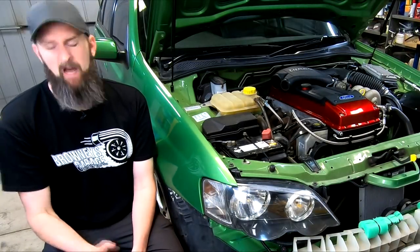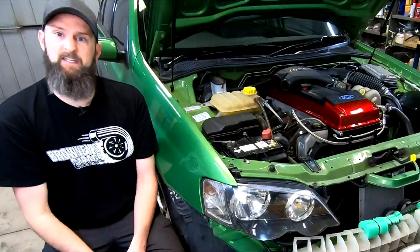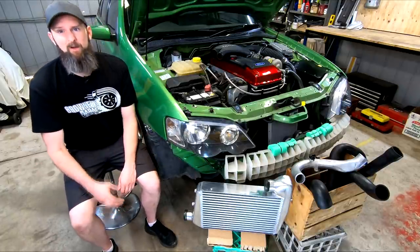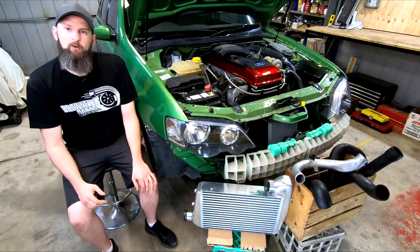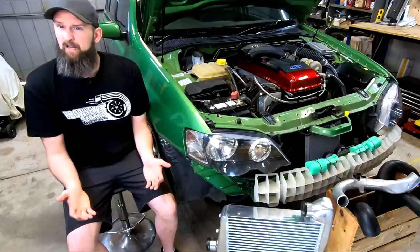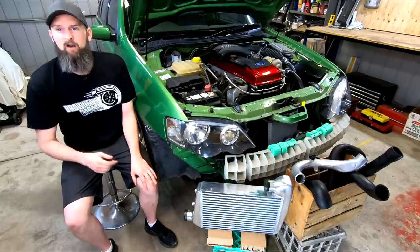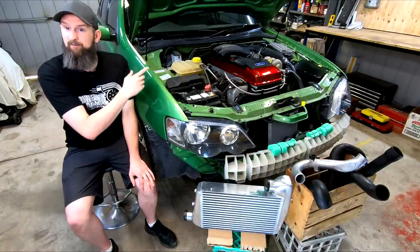That's where we'll finish up for this video — okay, not quite. I teased a first start with the turbo and I can't leave it without this. Bit by bit we have a near complete turbo engine bay now, but something is missing — the intercooler. Installing the intercooler up front may take a little more time than it would first seem, at least while trying to keep all the other oil coolers and show how to install a factory or slightly upgraded cooler like our eBay cheapo we have here. You're going to have to stick around to the next episode to see this finished off, and maybe even our first test drive. But right now I'm going to pull the fuel pump relay and crank the car to get some oil flow, then we'll try starting it and hopefully see that turbo spin for the first time on this car.